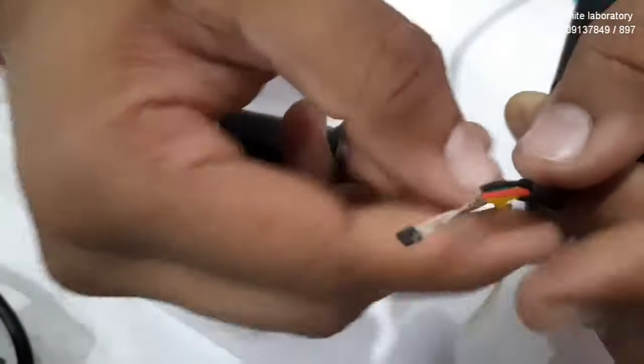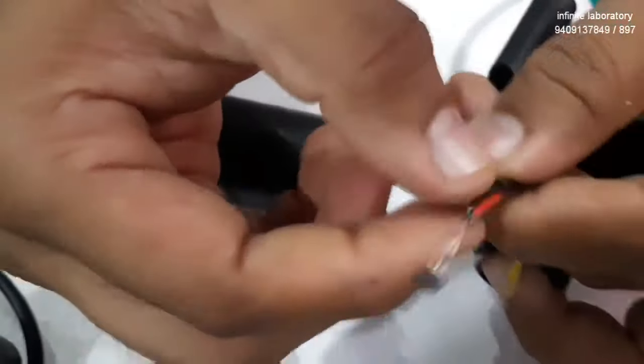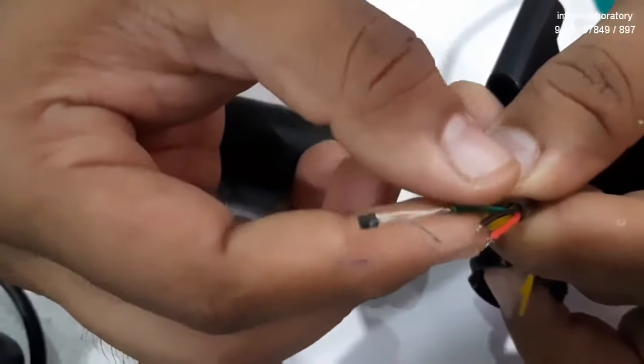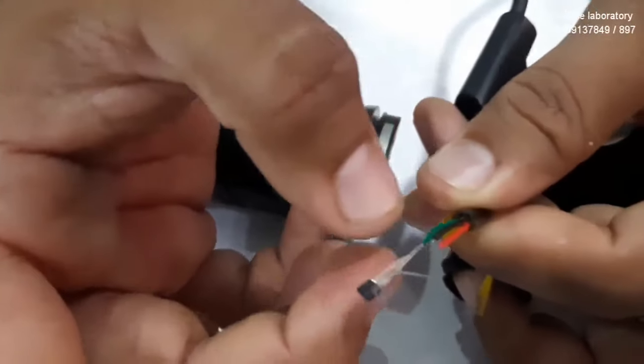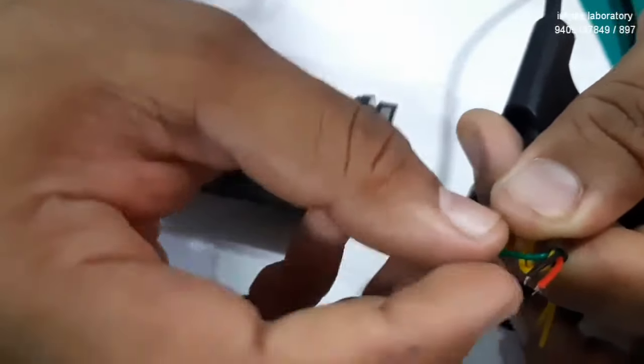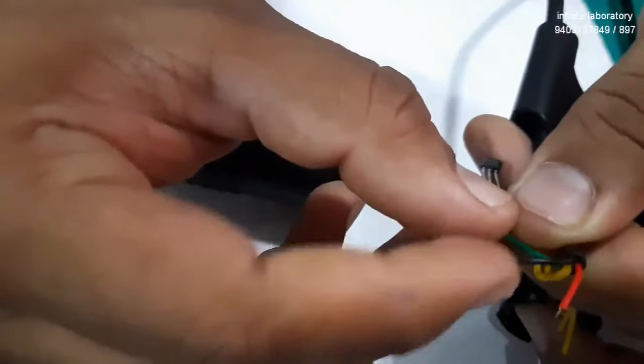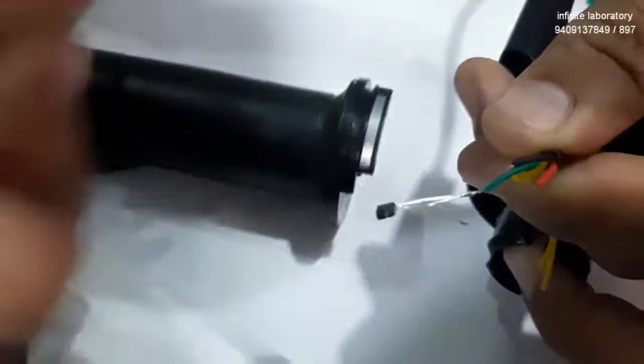This sensor has three legs. Generally all throttles come with three wires — red, black, and green. Some throttles have red, black, and blue, but green and blue serve the same function. Red and black wires are for the five-volt input; the black wire is for ground. So this sensor is continuously getting five-volt input from the red wire coming from the controller of your electric vehicle.